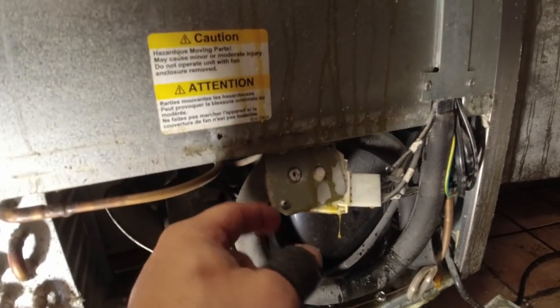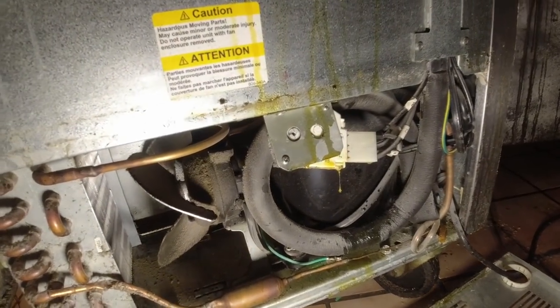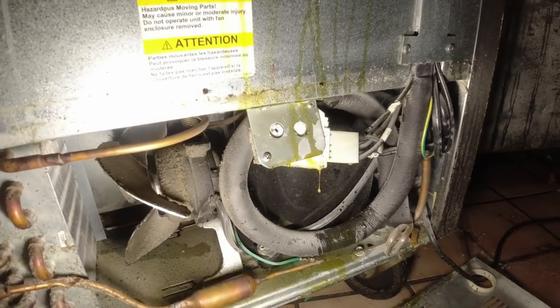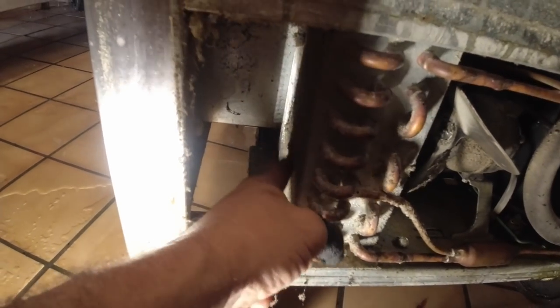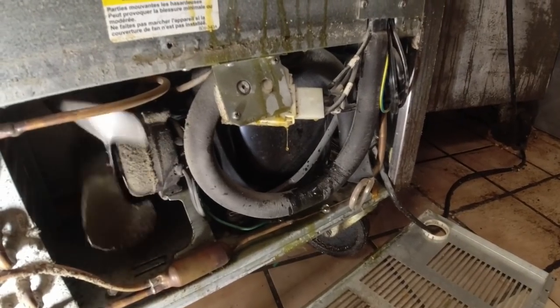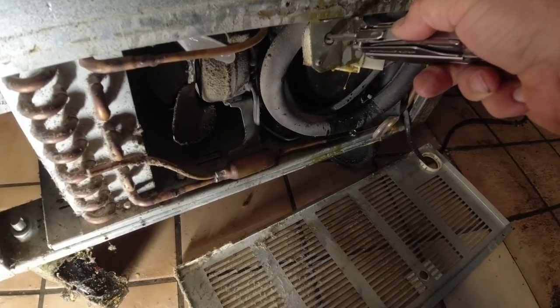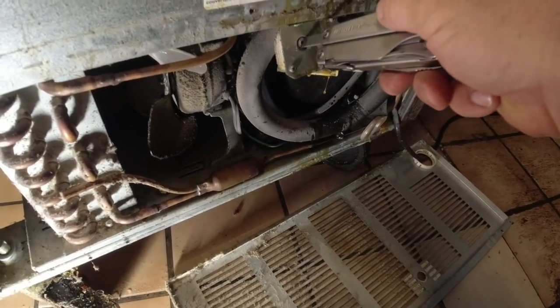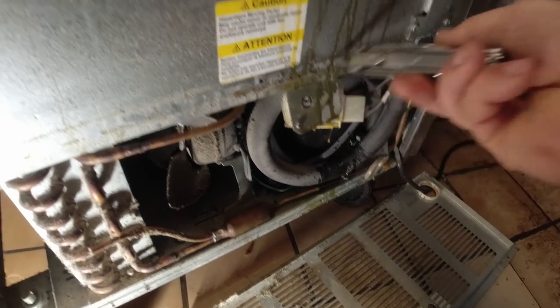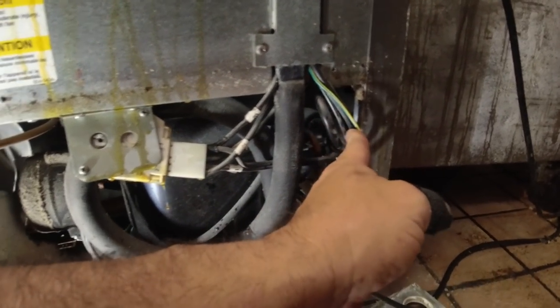That's unusual for me to see this kind of defrost clock, and you can see all the grease and crap in it — a crappy spot to put it since it just falls right into it. The condenser coil has quite a bit of crud on it. That clock turns freely, which is not good. There probably aren't any taps on this thing for me to conveniently check refrigerant.